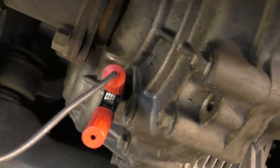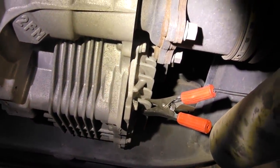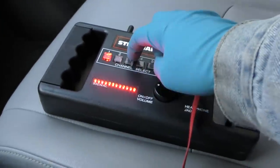So I'm going to do another test. I'm going to put number three on the rear end on the differential - it could be the differential starting to make noise. So we'll get the noise clamp off number three and put it on the rear differential here, so it's going to pick up any noise the differential is making. And just for kicks, we'll put number four on the right side of the differential too, so we get noise from both sides. We'll turn it on, have it on number three, and take it for a spin.